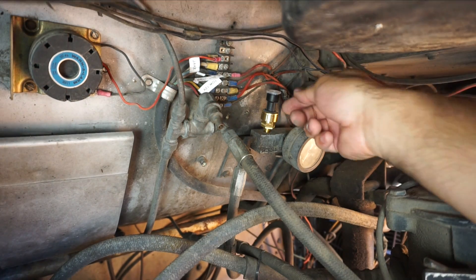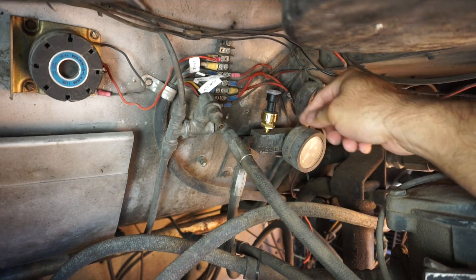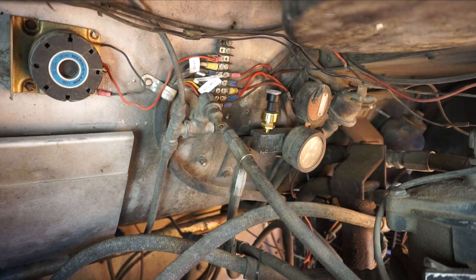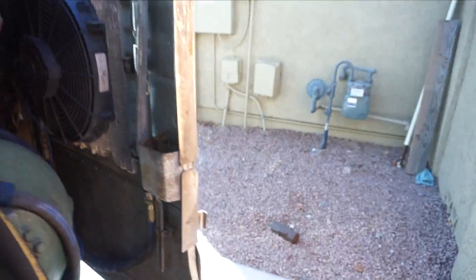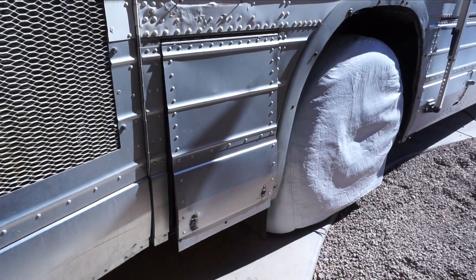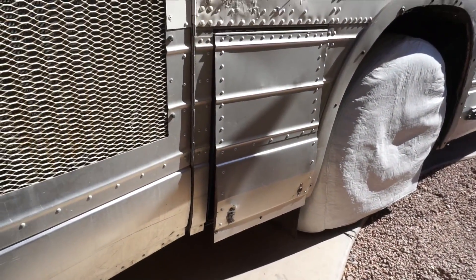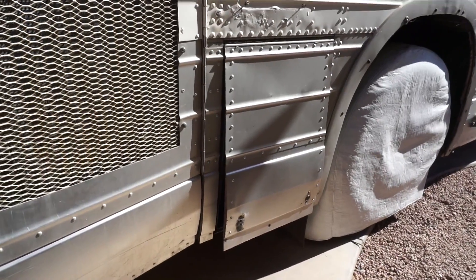The install is done. The next part is the harder part — we'll wire the signal cable to the existing wire and bring a new wire up from the control panel on the side where the electrical stuff is housed. There I'll take 12 volts, convert it to 5 volts, and run it up as the 5-volt reference.